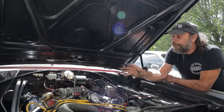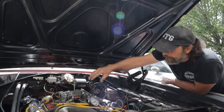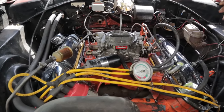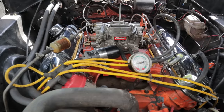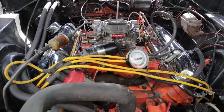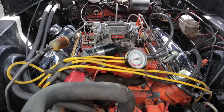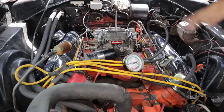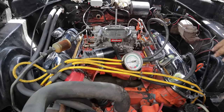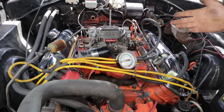So what things can you tune? How do you tune with a vacuum gauge? We've got this set up here on our Edelbrock. This engine, by the way, is a 440 - a very mild engine. Uncle Kathy built this a couple of years ago, runs like a top. It has a small cam, so it pulls less vacuum than the 360 in our Swinger. This is probably more representative of the average setup you're going to find - relatively stock engine, small cam, carburetor, headers. The one in the Swinger pulls around 20 inches of mercury at idle; this one pulls about 16 inches of mercury at idle.